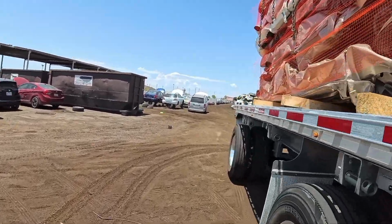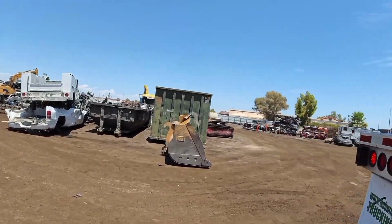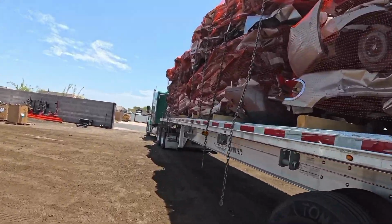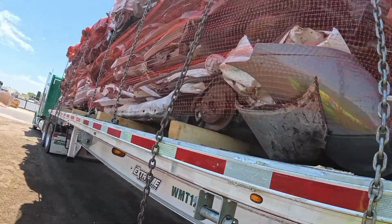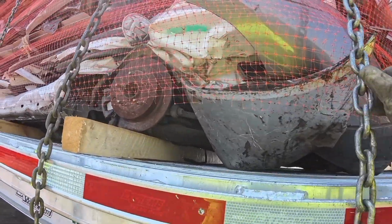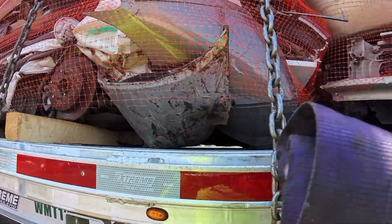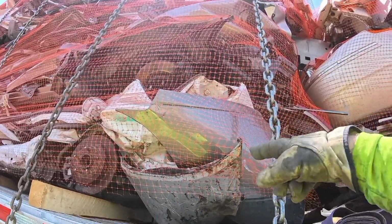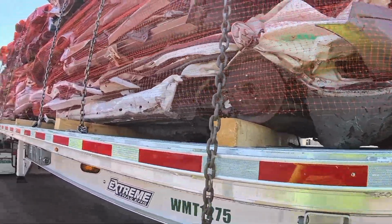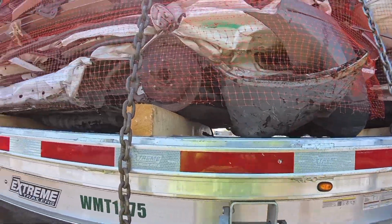So let's take a little walk around this, look for spots. Oh, here's a good spot right here. Okay, so right here, if I put my strap down, my strap's going to be touched by these pieces of plastic. Even though they're plastic, DOT says this cannot touch them at all, okay? So this area right here juts out a little bit more, and we can't let that strap touch that. So I want a chain extension on that side, and I want the D-ring pulling the other way.